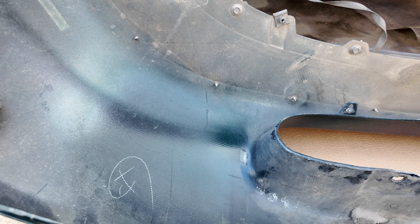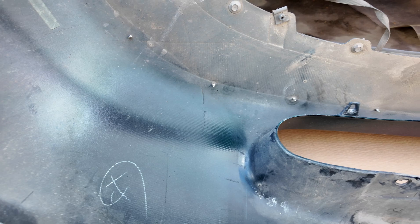This is without any of the cleaner — when you have the cleaner on it, it really shows up. Right in the center of the screen there's one of the X's they talk about; that center point is where you drill out for one of the holes. That arch right there, the dots scribed into a circle, that's going to be your cutout for the actual fog lights themselves. It goes all the way around, though it gets super light.